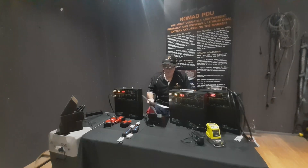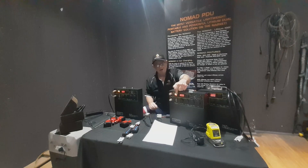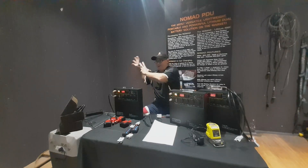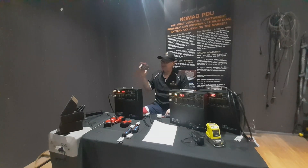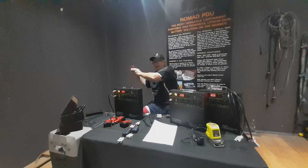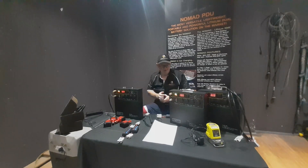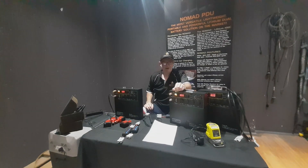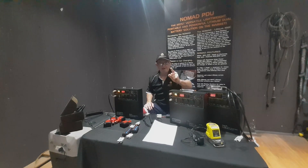Charging the Nomad — it's very important to understand regulated versus unregulated. When you've got an AC/DC charger, you plug it into the regulated input. This is also where you plug your solar panel if it's regulated. A regulated solar panel means the power coming from it already has a regulator on the panel — a regulator typically looks like an MPPT controller or PWM on the back, with little flashing lights. That's the controller regulating power from the PV before it hits the Nomad. It connects into the red Anderson. The regulator has a maximum charge rate of 25 amps — the most you can put into the unit at any time across regulated and unregulated combined.